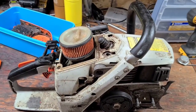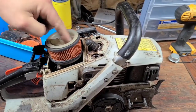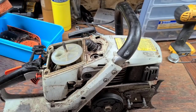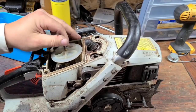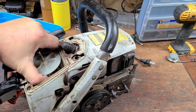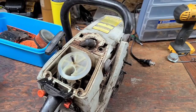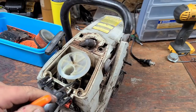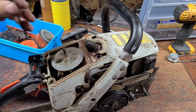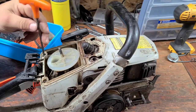I want you guys to be able to see — it's not all about me, it's about the saws, right? Nice air filter on this saw — she's nice and clean, so I don't know if that was replaced. It's funny, I have no clue how this even comes apart. Okay, we've got two screws underneath here, actually exactly like a 266/272. I'm going to take this top cover off. This carburetor — I don't even know what it is, I think it's a Walbro, maybe an HDA or an HD.